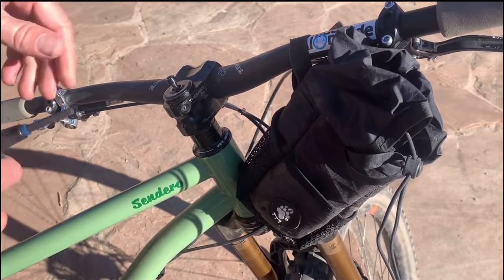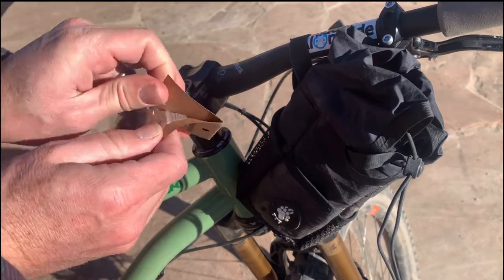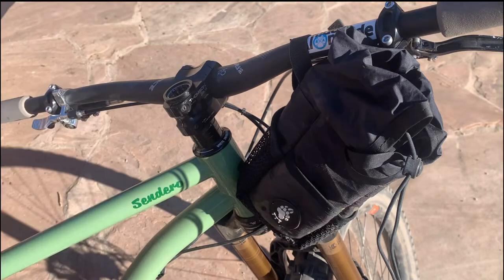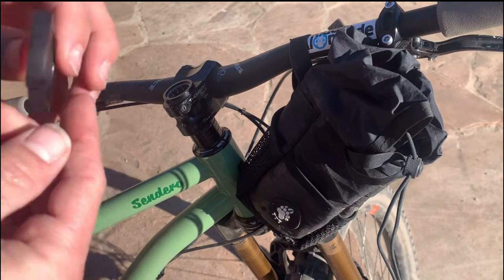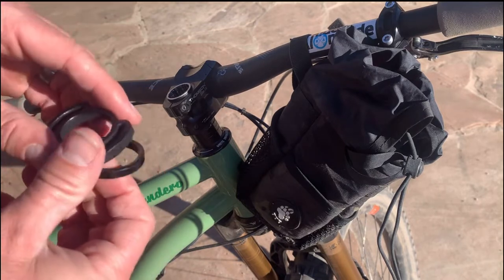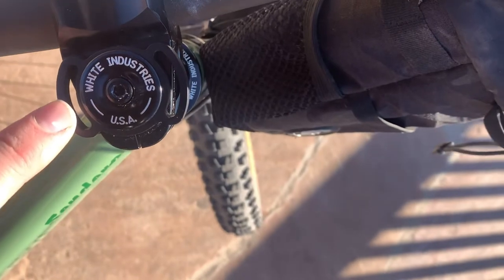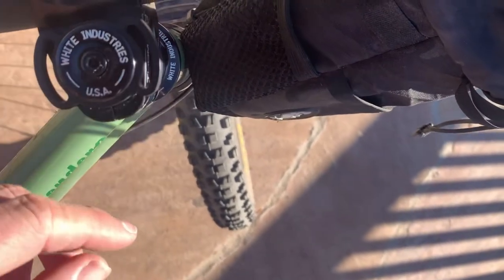It's just a regular five-mil spacer, and I've got one up here so I'm going to switch that out. It gives you a piece of one-wrap in there - pretty cool. The idea is that you put that in there instead of one of your spacers, whether it's above or below your stem, wherever you need it. Then you've got two points of connection for your feed bags. So let's get that on there. We've got this bolt loosened, got my White Industries headset cap. Even sealed up in a little Ziploc baggie - all of this feels very high quality, very boutique. These cottage industry brands, I just absolutely adore. So that's the headset spacer. Take this one off - here's a comparison between my old headset spacer and this Bingo Components B1. Throw the top cap back on. Right away, I'm seeing that there could potentially be a problem using it as the top spacer right below your stem, as these spaces here are going to be blocked by your stem a little bit. So let's see how that works.